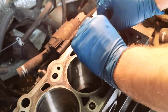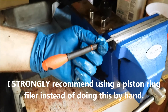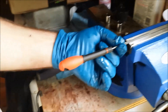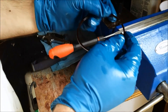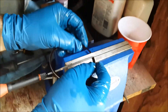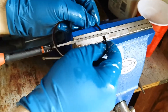I pull the ring out by compressing it, turning it sideways, and sliding it right out so I don't scratch the wall. I wasn't able to rent a piston ring filer, and I wasn't going to pay sixty dollars for one. So I put a key file in the vice — this worked just fine on the other three rings. I'm filing only one side of the ring, keeping it flat, because you want these two ends to meet up perfectly. I keep the ring flat against the file and drag it back.